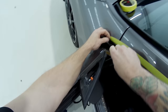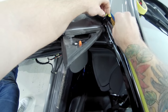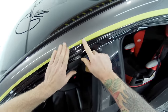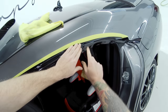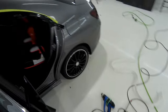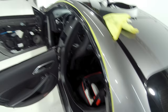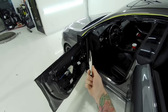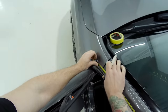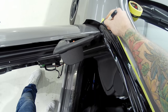Let's get down here and make sure it's a little bit tighter. Stick it to the tape — this gives us a clear view of where we're actually going to be cutting, which is important. As I always say in my videos, a fresh blade is the best blade. A sharp blade is also the safest blade. If your blade has been used several times, snap a new one off before you start cutting. We're going to insert the knife in the back edge of this trim — and don't push hard. If you push hard you will cut the rubber seal on the inside. You don't want to do that.